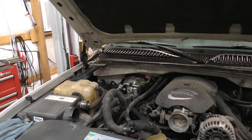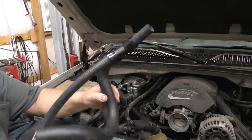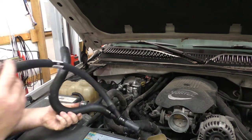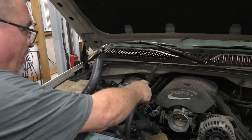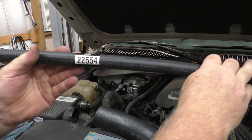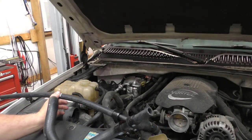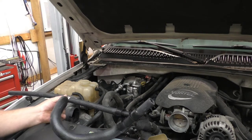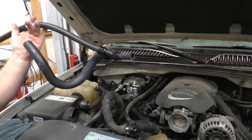These are now readily available. This one here is a Gates — this is the hose assembly that we need, there it is in one piece. Of course it goes from your filler tank down to the thermostat housing and also goes back to the heater — that's the reason they call it a Y. The part number on this is 22554. I've found over the years that your best bet is to go with Gates. They seem to do better than the cheaper versions, so if you have access to Gates I would definitely opt for them.